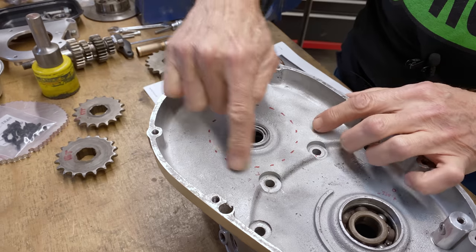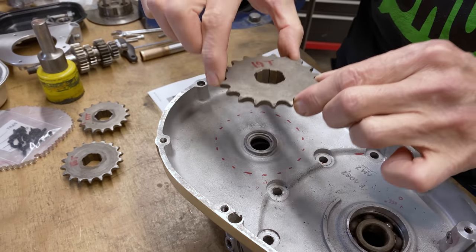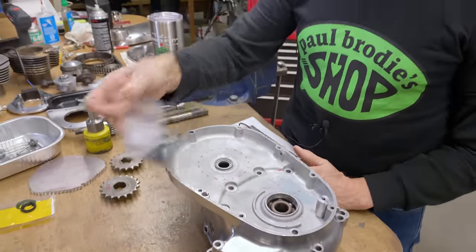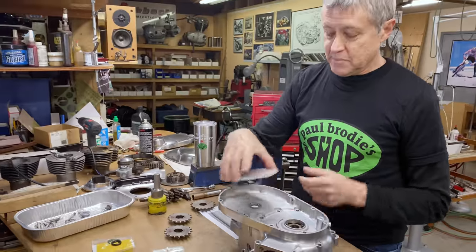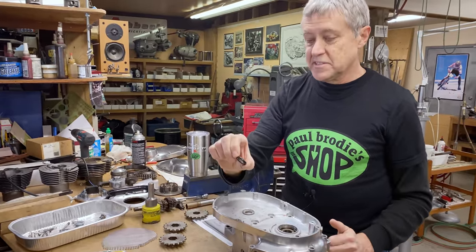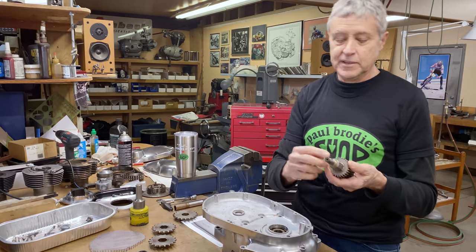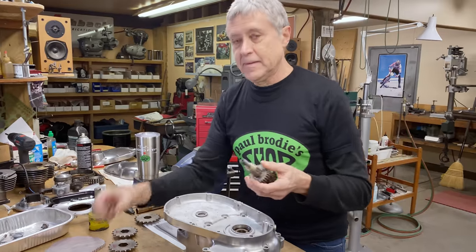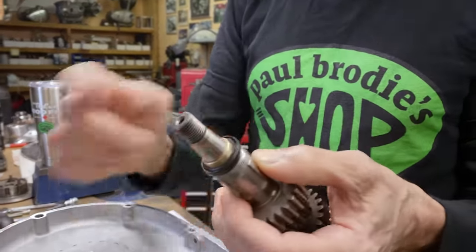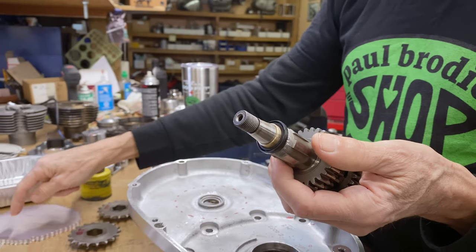I don't have enough room here in the metal to put a 19 through there because the sprocket has to go through there. I've got little Allen screws to hold on the plate. That's going to be the plate there — I found a piece of aluminum. I've got a little oil seal I wanted to show you. I've been working on the transmission a little bit. I've got a bushing here. This is where the oil seal goes — it goes over top like that. That seals the case. This oil seal goes into that one-quarter-inch aluminum plate.